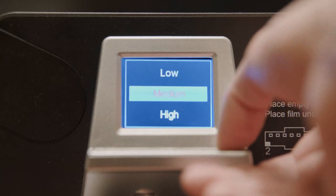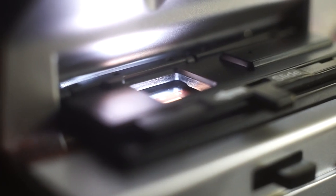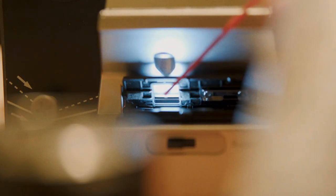The scanner has three levels of sharpening: high, medium, and low. I left it on medium for all of them, and there's weird artifacting in some of the scans. I've also noticed a kind of hazy glow around the edges in certain areas. Another big problem is that the bed of the scanner is very difficult to keep clean. I ended up hitting it with an air duster and a microfiber cloth in between every reel I processed. It's pretty apparent when there's dust on the scanner bed — when it's on the negative itself it'll roll by frame by frame, but when it's on the scanner bed it will stay static throughout the entire scan, which could look pretty ugly.